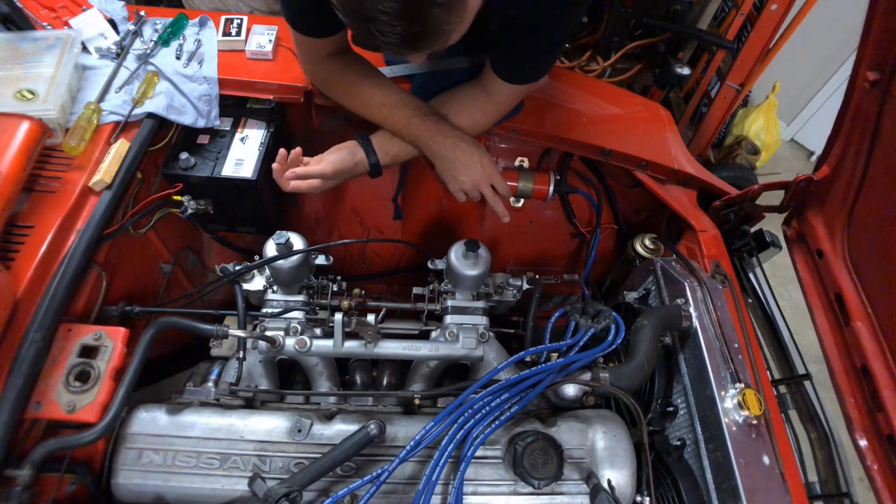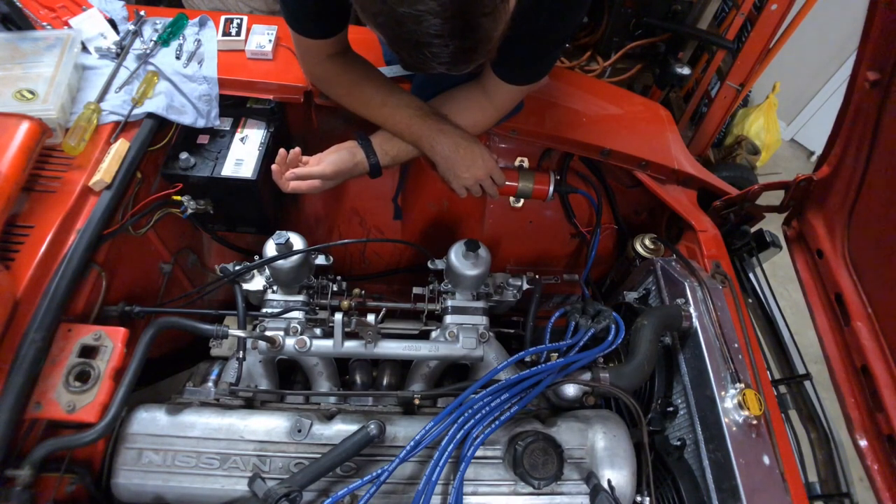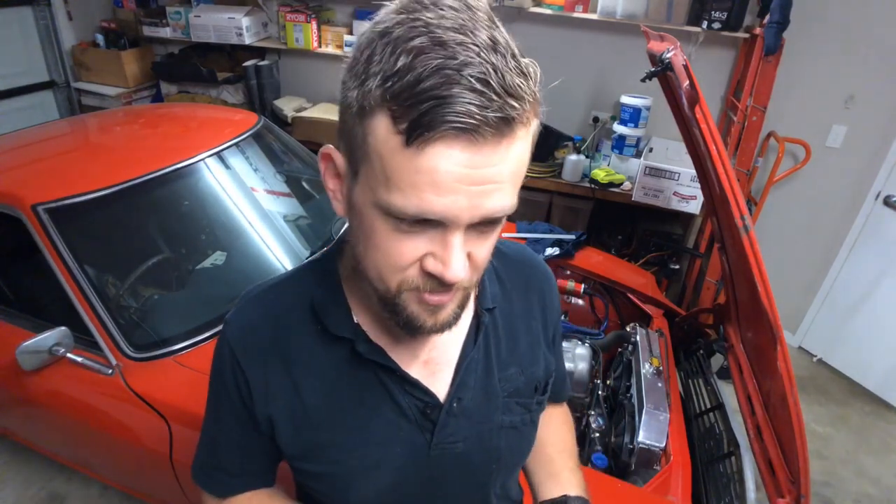It's a bit of trial and error and mucking around. The gaskets probably take a little bit of a flogging, so I hope they stay together. That's how I adjust the fuel floats in the SU carburettors. I'm a bit defeated by time — despite my best efforts, I'm not going to get to a test drive and reviewing the data in this episode. I'll feature that in the next episode. In the end, I got both to sit around 13 to 13 and a half millimeters. It's not quite the factory spec, but what I'm trying to do is get it leaner, and when we get to testing and data logging, that'll determine whether it's done the right thing.